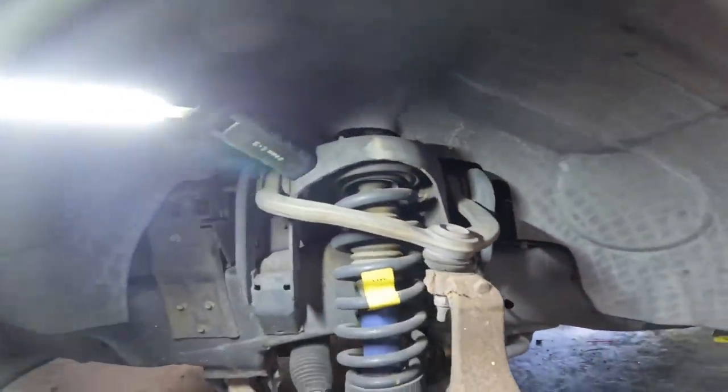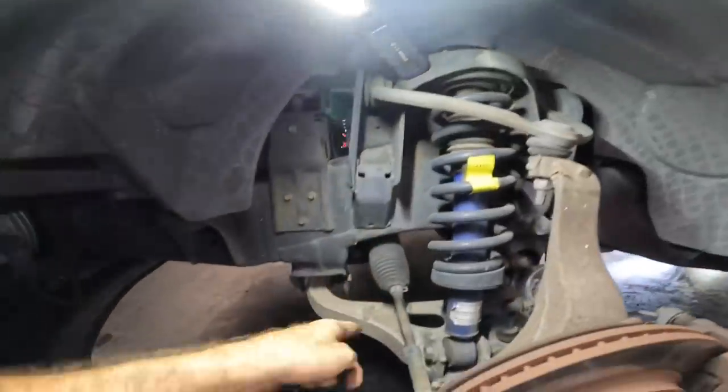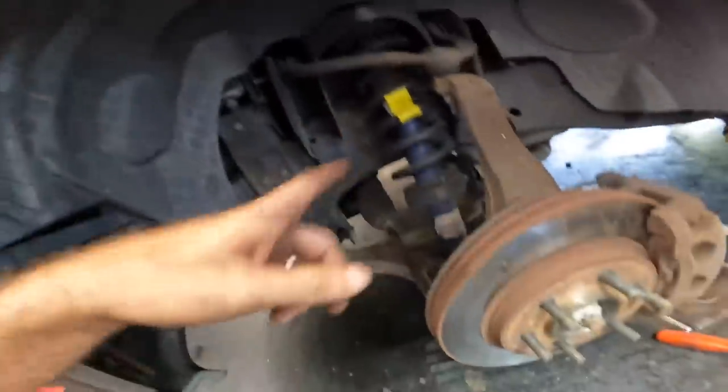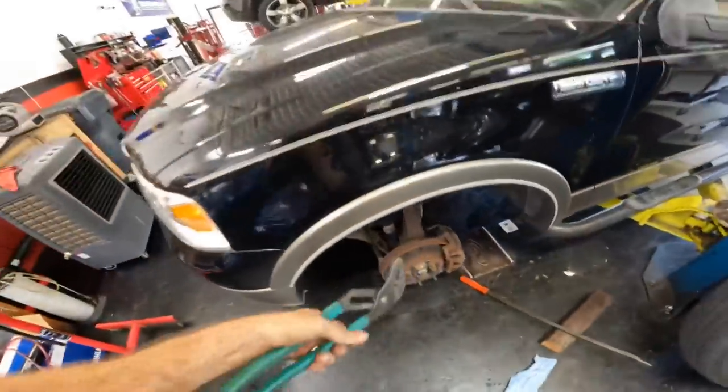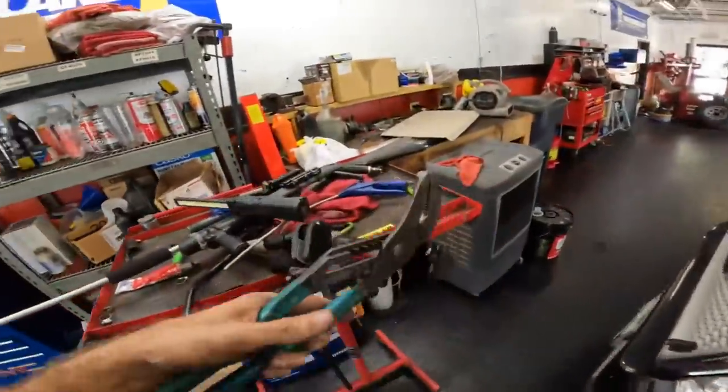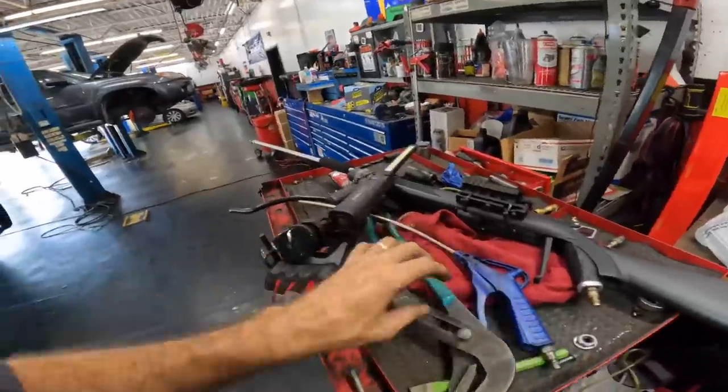I am gonna go ahead and recommend both uppers, both lowers, and a wheel alignment. Those lowers and that right front upper are actually so worn, I would consider them safety issues at this point. A good solid pothole can knock one of those guys loose when they get that flippity floppity, and/or weebly wobbly.